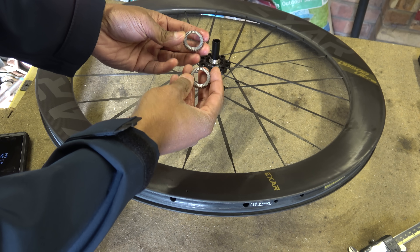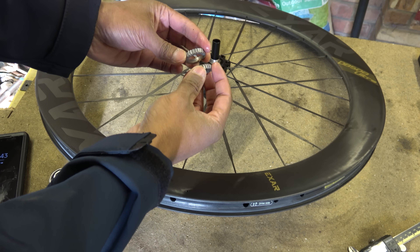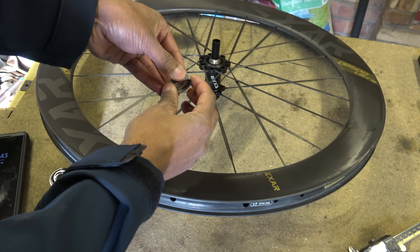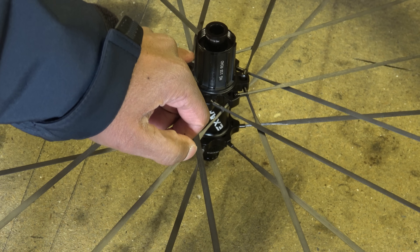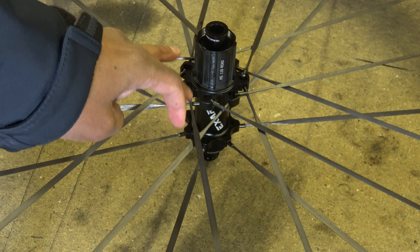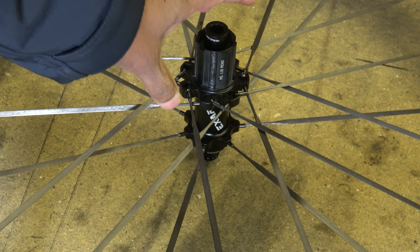On some hubs coming out of the Far East these things aren't machined — they're basically rough. This one is machined and it's been pretty flat too, with no issues in terms of engagement. It's very quiet — you can actually hear it, that dull noise — it's not very loud at all when riding. The freehub does show some bite marks. It's not hard anodized like some others, so if you're putting a heavy load through it, it's going to mark. In inclement weather it's more likely to stick, and you might need a hair dryer to get it off.